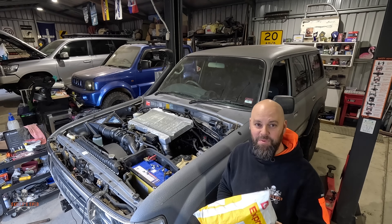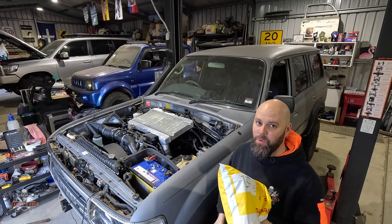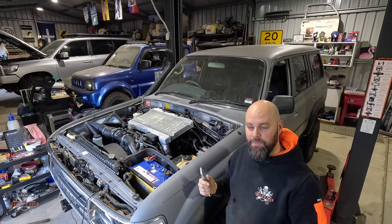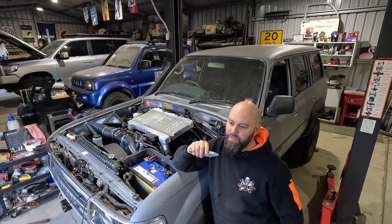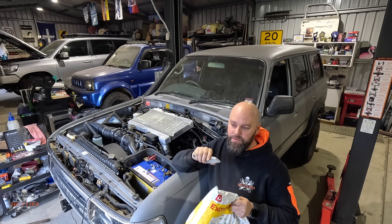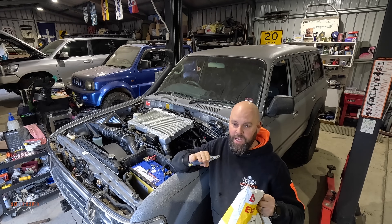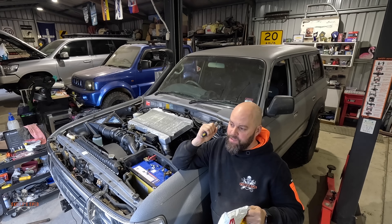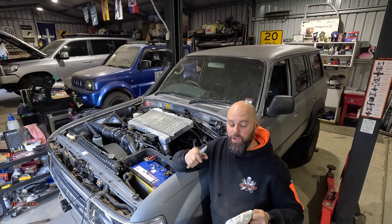ECU's back from Off Track. Hagen assures me that it works in his 105, so in theory it should work in mine. What had happened was we'd done an immobilizer delete on the ECU and for some reason the software just hadn't done it properly. They've redone it via OBD — the onboard diagnostics — and now it works.